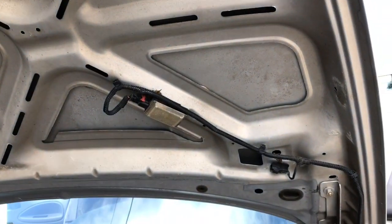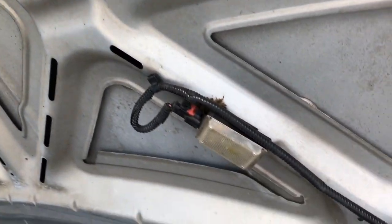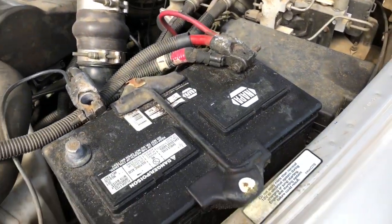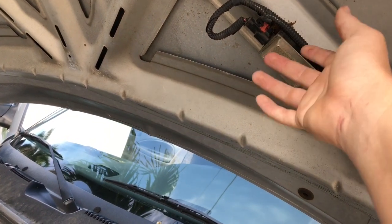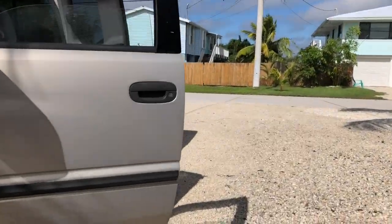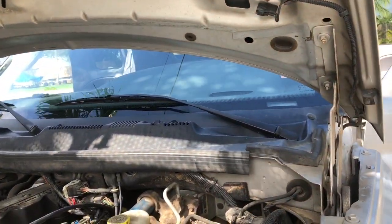Then you just mount your wiring from this connector, and there are holes that you can use your plastic rivets for — then hook it up here. The second hole is for my light. This is another reason why I think it's a fuse that's blown: when this opens, sometimes it's a little iffy on engaging. Obviously it's not going to engage now because the batteries are disconnected. Sometimes it clicks on, sometimes it doesn't — that's because I messed with this connector once. Sometimes I just give it a tap and it engages, but I tried that with the batteries on and it wouldn't engage. My cargo lights don't work either, and that tells me there's probably a blown fuse.